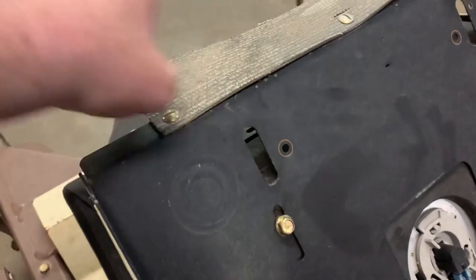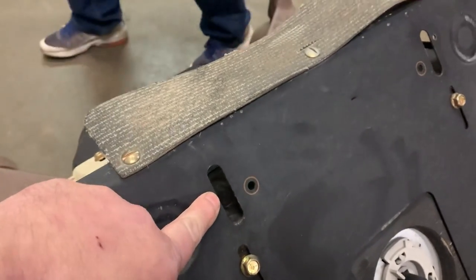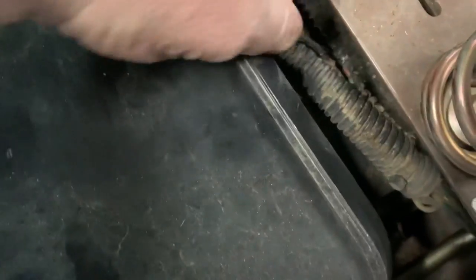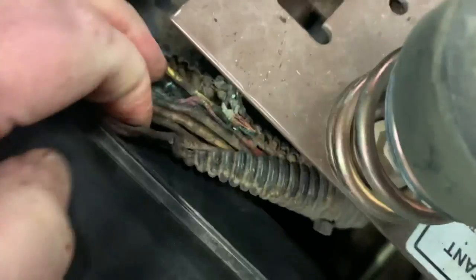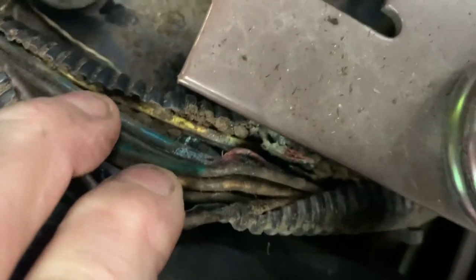The main deal is that this seat used to have — yeah, a couple of those — used to have these hooks, and whenever you would come back here to latch the seat, these hooks would come down into this slot where the wiring harness is. And this wiring harness has just been compromised. Look at that wire there — this whole harness just needs to be replaced. Look at all the corrosion.